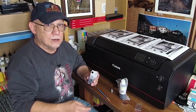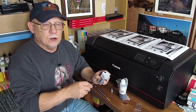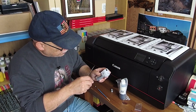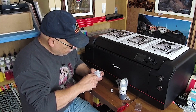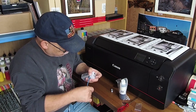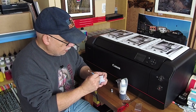Make sure that you do not accidentally swap cartridges — do one cartridge at a time, not multiples. Do not remove all of the caps first. If you saw the video by Precision Colors, it's very simple: there are several tabs that you need to pry off. I like to just go in through here — there's one located right here — and I'm using a little brush since I don't have any Q-tips. You just have to keep prying it off so you can remove the other one, otherwise it just keeps popping back in place.